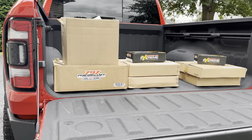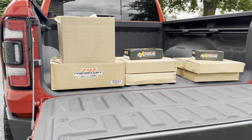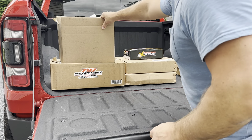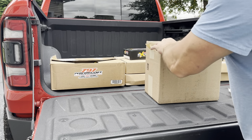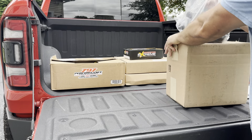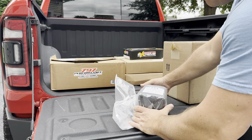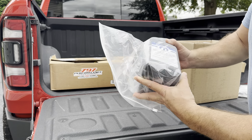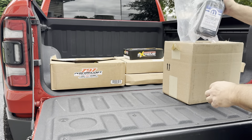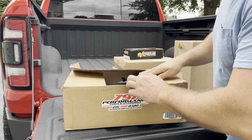Let me get this stuff unboxed for you so you can see what I have and what's needed. If you have a Ram TRX and you're doing your 30,000-mile service, this is the stuff you're going to need. You might not need brakes, but I drive fast and I tow a lot with this vehicle. Transfer case fluid — very important that you get the Mopar stuff for the Borg Warner transfer case. It is proprietary to that transfer case. You need two quarts, so make sure you get the right stuff. These guys know what you need and they'll hook you right up.